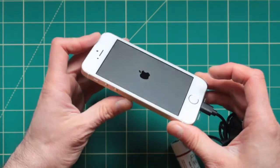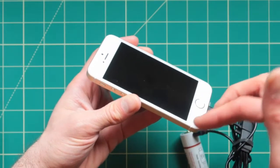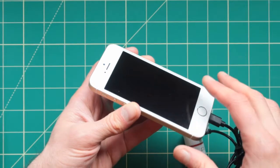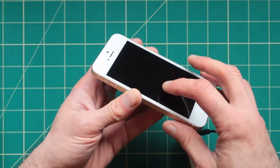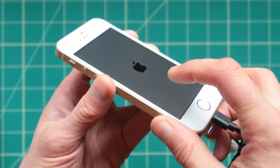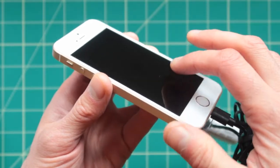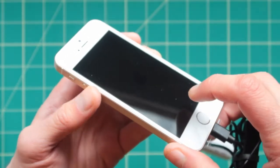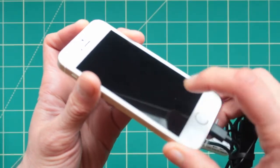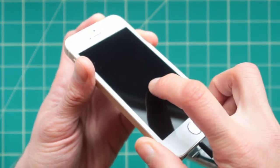Which leads me to believe there is an issue with the system not being able to boot because the battery is old. You can see the battery right here. It's very, very hard to see it when it goes to the Apple, and then it flips after a while, goes back, and it shows you the battery charging scene. I don't know if you can see it right here. It's very hard to see, very faint because it's lacking power.